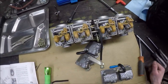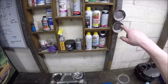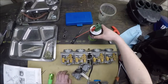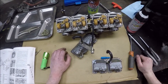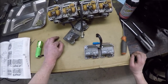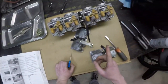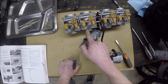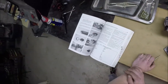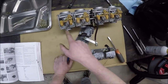I'm not going to be doing a whole carburetor rebuild, just shooting some carb cleaner and compressed air through all the jets and passages. Everything looks good. The manual says the pilot screw should be set out to three turns, and I had just set them all to two and a half. So I'm going to set them all to three turns. With a more free-flowing exhaust, I'd probably want a richer mixture because there's more air going through it. Three turns out — that's where all these are going.